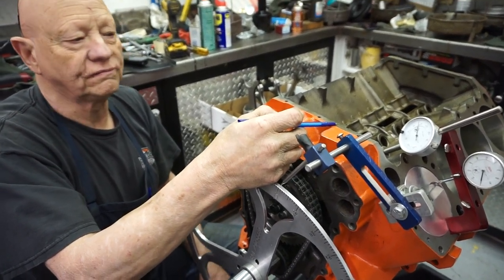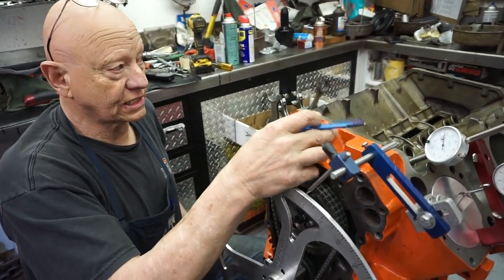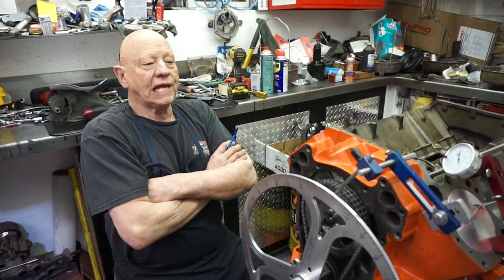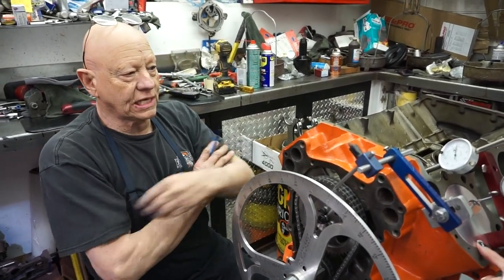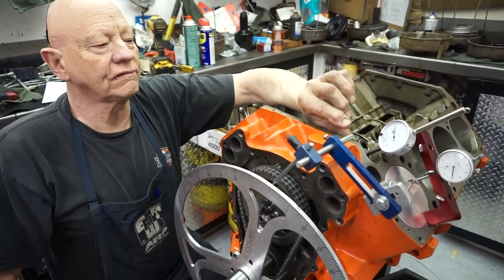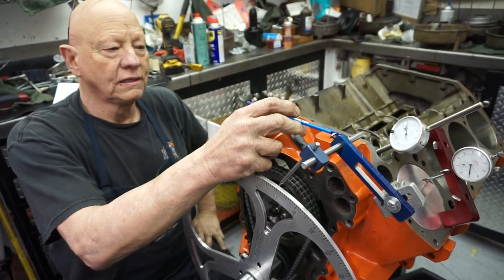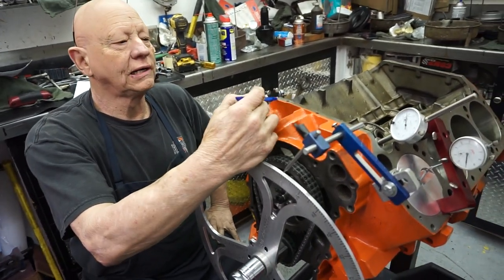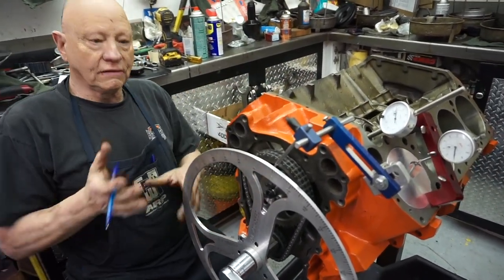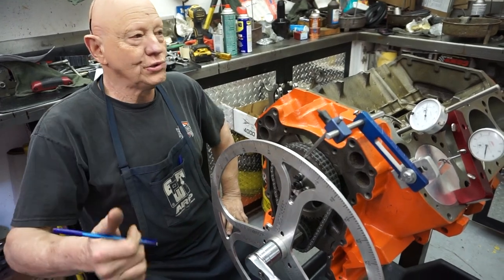Where a Chevy and most of the Ford stuff, they've got a big rubber gasket that went across here — and some of them actually had holes drilled in them. But you start messing with the deck of the block, the surface of the heads, any of that stuff changes the location of the manifold. Then this area will go down — you put it together tighter than it's supposed to be, so it cinches up. You don't think anything about it. Well, a few thousand miles later, it spits it out. Now you've got a massive oil leak. Back probably in the early 80s, a lot of guys would go in and drill a bunch of small holes or take a center punch and pin it across here to give the gasket a little more to hang on to. Then it was common to use weatherstrip cement to glue that rubber down, so you have basically a bond all the way across.